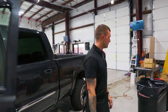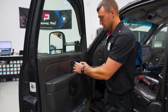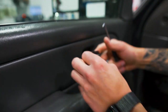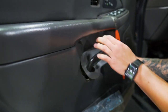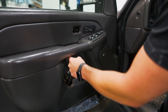Starting with the disassembly of the door to pop the panel, then we'll do the inside prep. To pop the panel on these '04 GMC — same thing as the Silverado — we take out the lock switch from the front, pop it with the hook tool from the back, pull it out, take off this plastic piece, then from the front with the handle up slide that off. We have a seven millimeter here, a seven millimeter here, and usually one on the bottom.